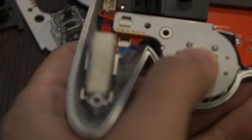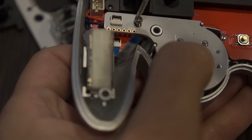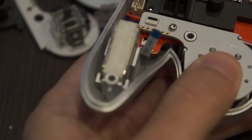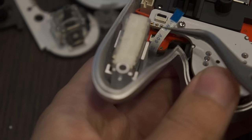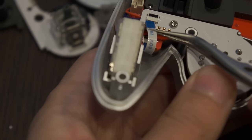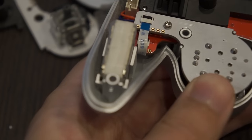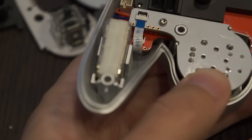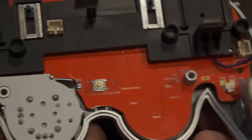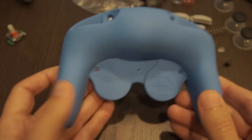I'll probably move that connector over just a little bit so that it's clear. This little stick board just fits right in — I do have a screw that can hold this stick board in place. Then we just lift up the top connector, plug that ribbon cable in using some tweezers, and close it up. That is the sub analog stick assembly.